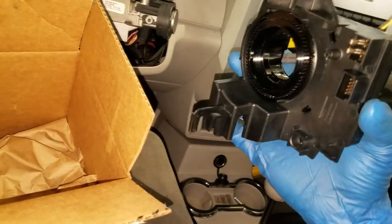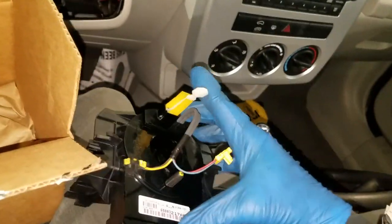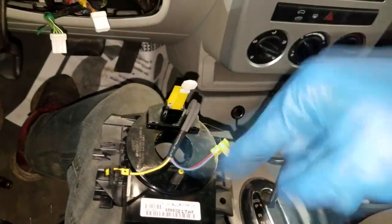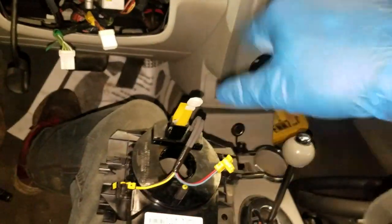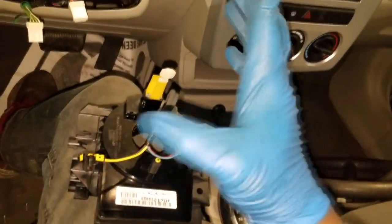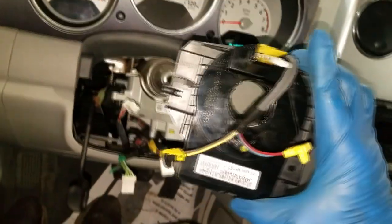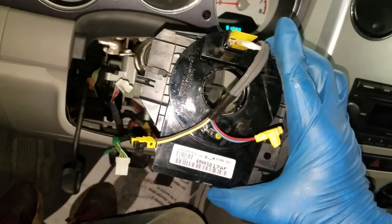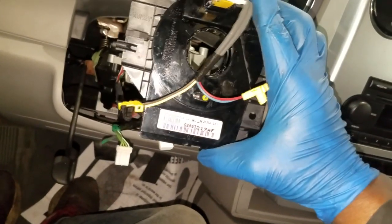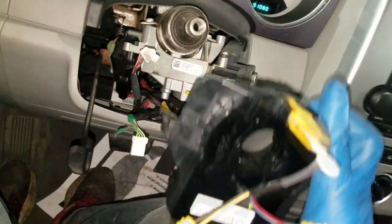When they build these, they center them, put the tab in, put it in the box, and seal it. If this were a used clock spring you might have a hard time. You can do it — I've had to do it a couple times where you turn it all the way one way until it pegs out and go all the way the other way until it pegs out. The goal is to find the center position, because you don't want it too far one way or the other — you can easily snap the clock spring when you install it or when you turn. So let's get this new clock spring installed.